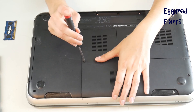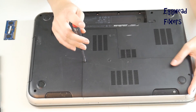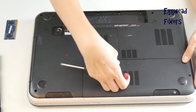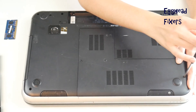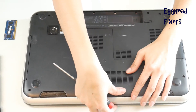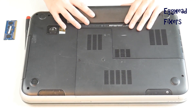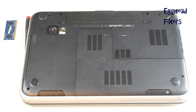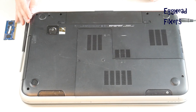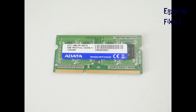At the end of this video we help you out by showing you what to look for and how to order another RAM stick, including the make and kind of RAM you have shown in a picture. We also tell you how to continue troubleshooting if it isn't your RAM stick. Now plug your computer back in and try turning it on. If your computer springs to life, you know it's a problem with that other RAM stick — it's time to order a replacement.